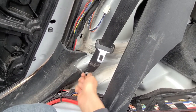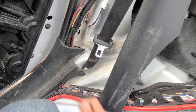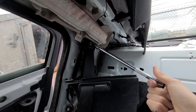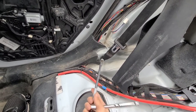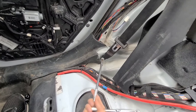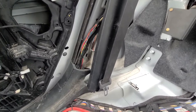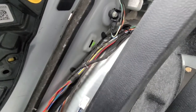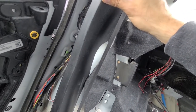There are a total of three screws holding the rear seatbelt and they're all Torx T50. Now you can use your ratchet to tighten them up, and once you have tightened all the bolts you can install the plastic pieces back — they will all snap into their holes. There are a bunch of plastic clips, both the top part and the bottom part, and that's how you install the rear seatbelts.